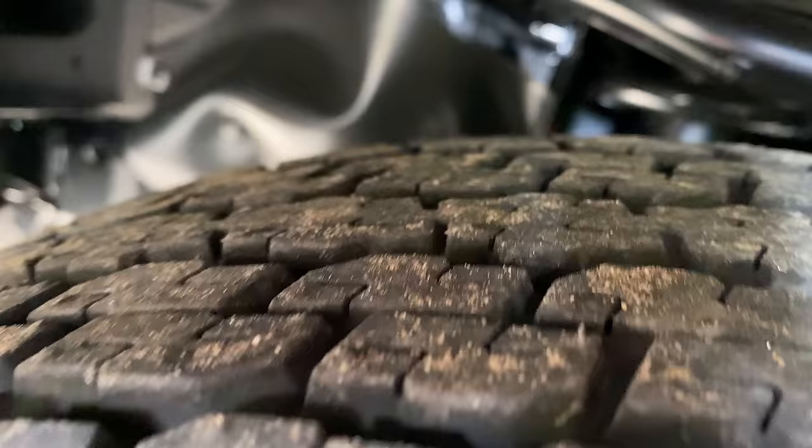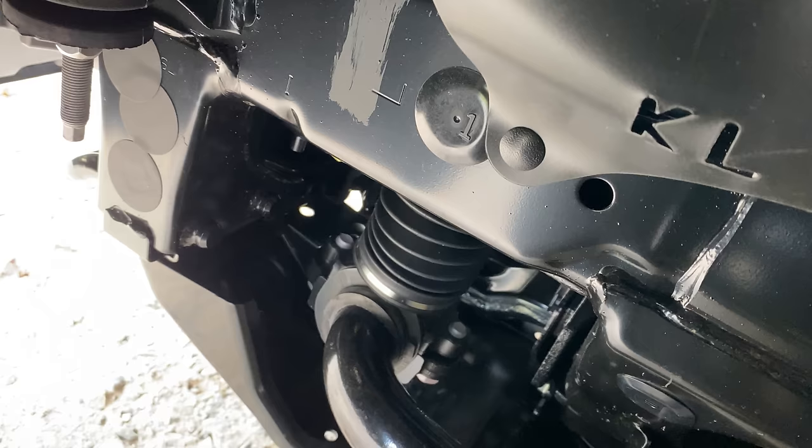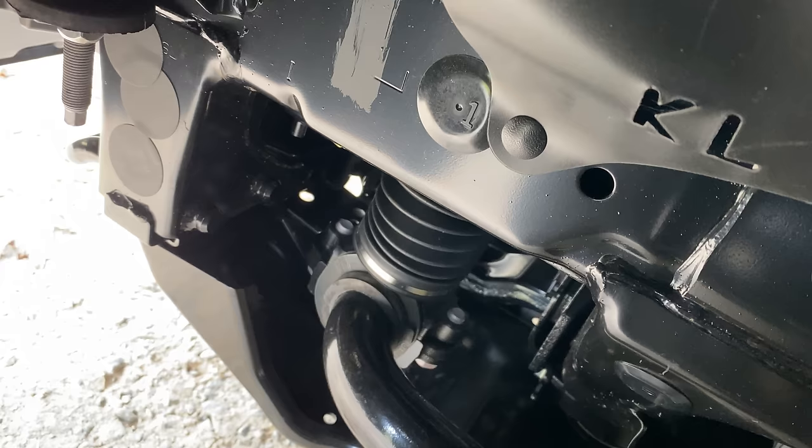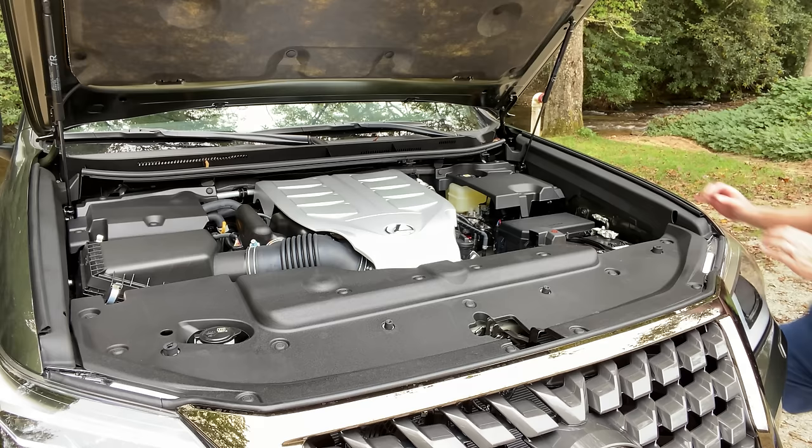What does KDSS look like? Traditionally, you have a sway bar that's a one-piece design — it looks U-shaped. This one has an articulator or shock on either side, so it can flex independently. One side can twist and be flexible while the other is stationary. It allows you articulation, rebound control, and performance — a smooth ride on the road and a tough ride off the road. This is matched with a six-speed automatic transmission.